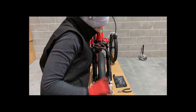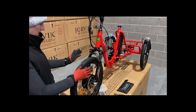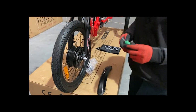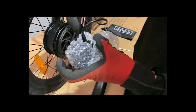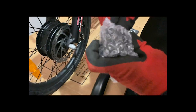Just lift it up and give it a little bit of a turn — that moves nice and freely, and your front wheel is on. Next step is the fender. So grab your front fender, remove it from the packaging. You're going to need the number five T Allen key, and you're also going to be fitting your front light as well. There's a cable coming into the front light here — just push that in, make sure that's nice and snug and tight, and then take the light out of the casing.